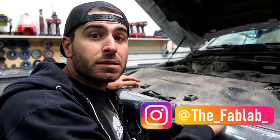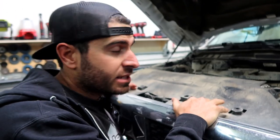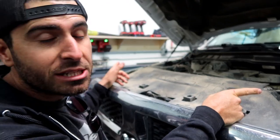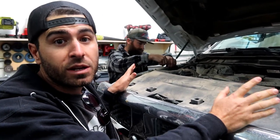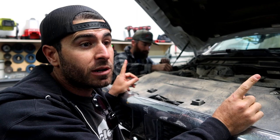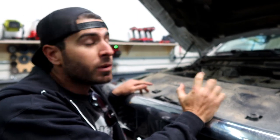We're here Saturday morning at the fab lab in Simi Valley, California. My buddy Mike is gonna help us install the truss. First thing you want to do is disconnect your batteries — that protects your batteries, your charging system, and your computers in the vehicle when you're welding. That's step number one. Then we put it up on the lift and put it in neutral so it's a little easier to maneuver on the lift.